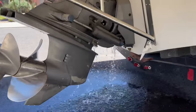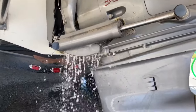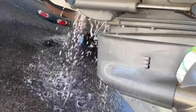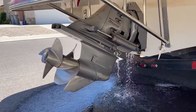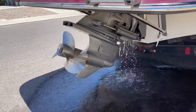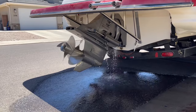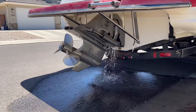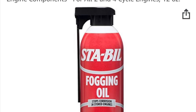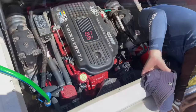With it running, the water will now come out the exhaust — that's how these boats are designed. Keep in mind you have the propellers here, so make sure it's in neutral. Next, with everybody standing clear and the hose out of the way, put the boat into drive and make sure that everything spins. Do not stand close to these — stand back, because if they came off they would be very deadly. Then stop it, put it in reverse, and make sure it works in both directions. You don't need to run the boat too long, just enough to know that everything works. Also during winterizing they will fog the engine — spray some oil inside — to keep everything from rusting. You might get some smoke in the beginning and if you do it's okay, just let it burn out. You also don't want to be dumping that in the lake, so another good reason to run it outside of the lake.